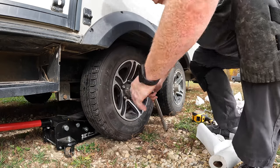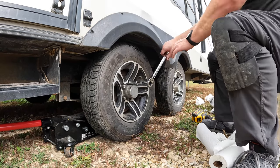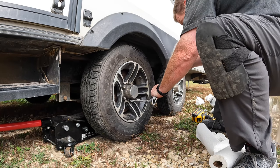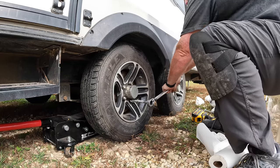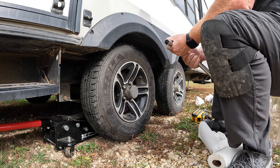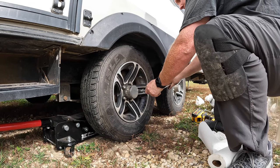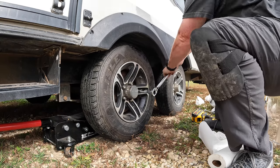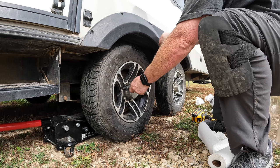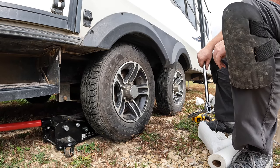You can actually even let it down at this point. Okay, now the tire moving on here. Okay, I'm gonna click. Move it down here. Click. And as you're tightening, you want to tighten one there, one there, one there, one there, one there. Got the idea. Like I said, it gives it a more even distribution there.